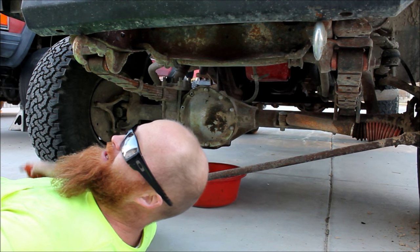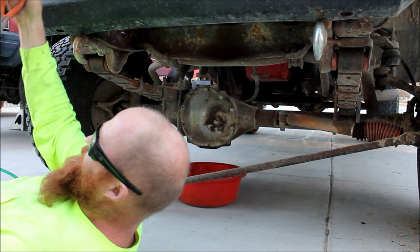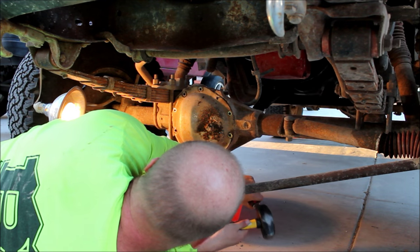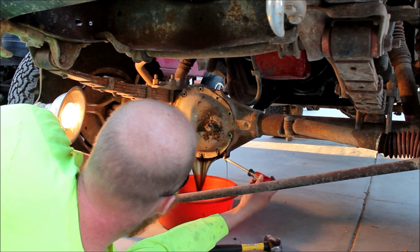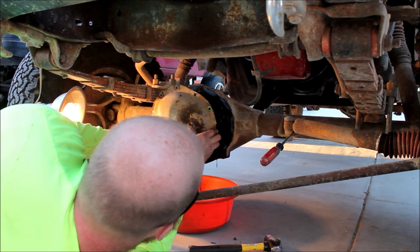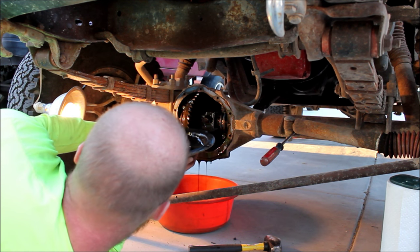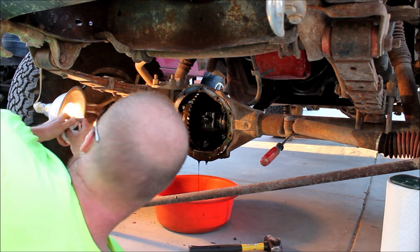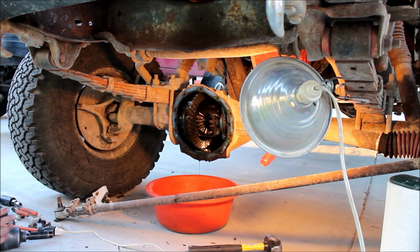You know, it's pretty bad — I didn't even know these acorns were on here. You haven't checked your fluid, have you? I haven't. I've had this truck for like a year. Well, no water so far — that's a good sign. No bubbles. It's dark, but you've got a rag. I should feel guilty for never having checked this. Like you say, it's a 10-bolt. If I cared about it, I wouldn't be Lincoln locking. So you pull the diff cover and drain the gear oil out, then hit it with some brake cleaner.